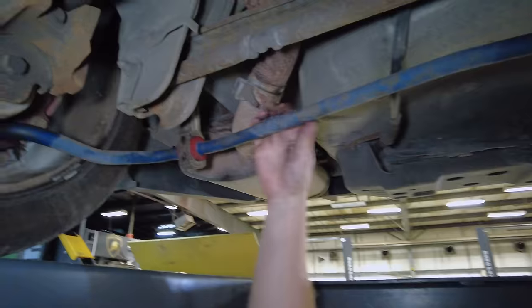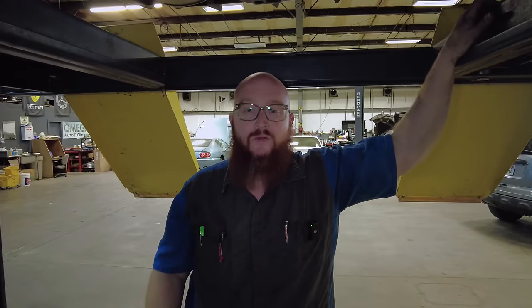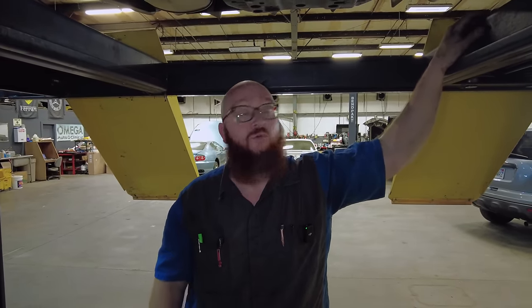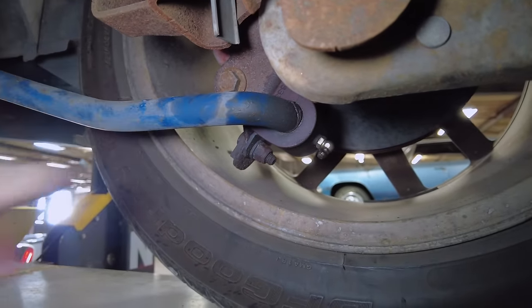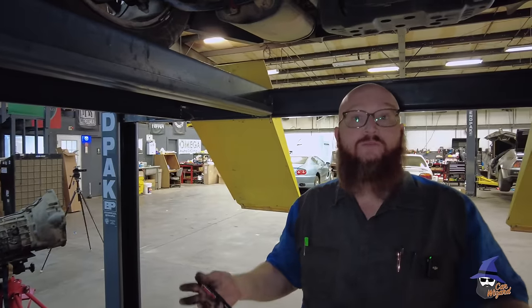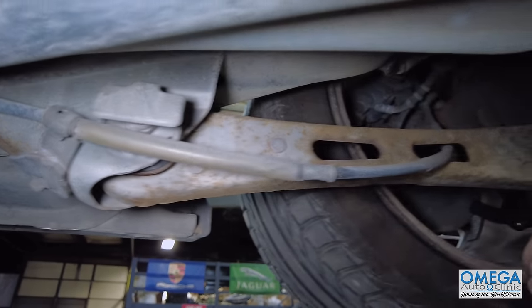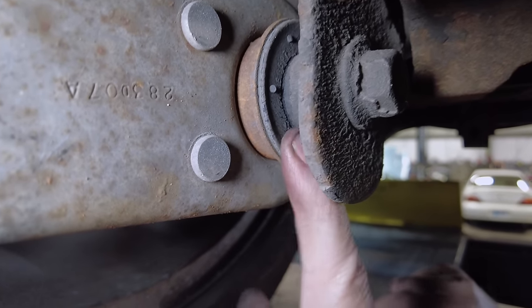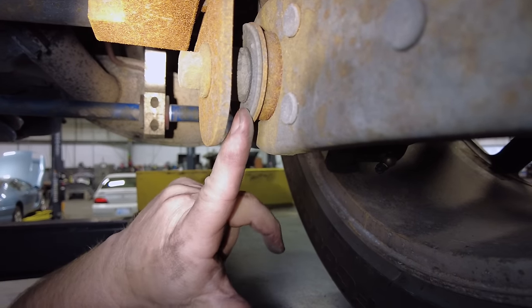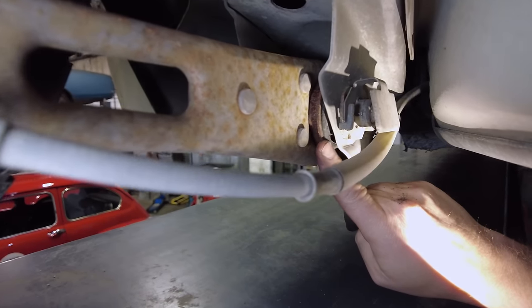The same thing is going on back here with the bushings. In the rear, the sway bar links bolt directly to the axle with a bushing there — it's pretty tight, not flopping around. I have brand new trailing arms; it's just as cheap to put the whole arm on. The rubber bushings here are separating, and the center core portion shows a ring around it because it has physically separated from the rubber. Same thing on the other side — you can see a dark circle around the center portion and cracks all through the rubber on the forward part.